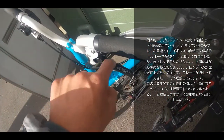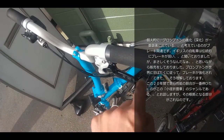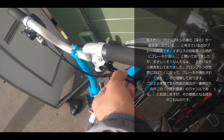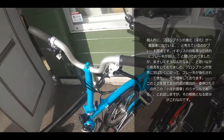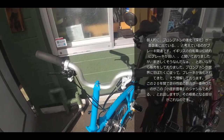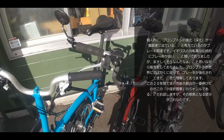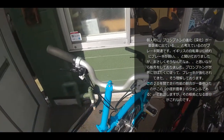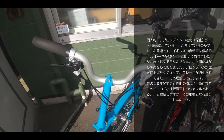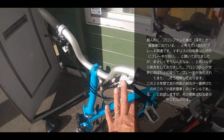From around the early 21st century, the UK model adopted this brake lever. The lever itself is metal, but the base mount is still resin, so force was likely still being lost. Then, from around the 2013 model, this new brake lever was adopted — both the lever and the base are now metal. The caliper also has ribs — reinforcing holes — which prevent the caliper from twisting or flexing, dramatically improving braking power. Brompton used to be criticized for poor braking up until around 2011 or 2012, but after this lever change, those complaints almost completely disappeared.